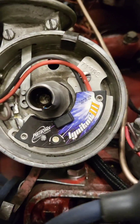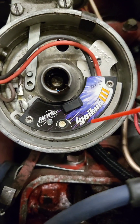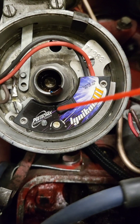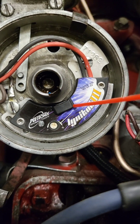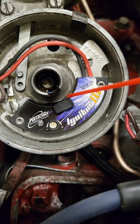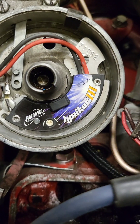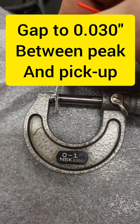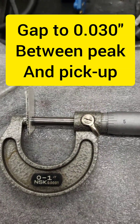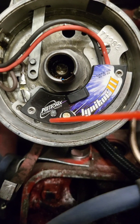When I went to install this 71282 ignition pickup in this distributor, it wouldn't fit at all. The easiest part was just drilling a few holes in the breaker plate to get this thing in the proper position. We need to pay attention to two things. One is the gap between the top of the point wheel and the pickup — the gap should be 30 thousandths of an inch. Take your micrometer, and I found a piece of paper folded in two that was perfect for that gap. Set it in there and push it tight while you tighten the screws.